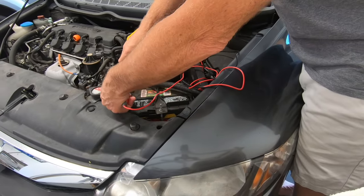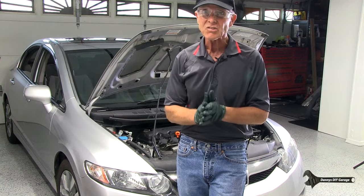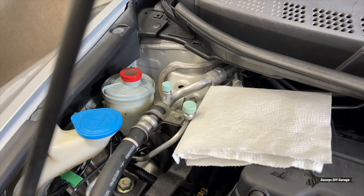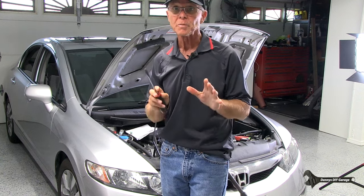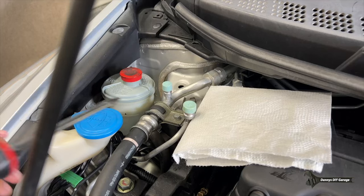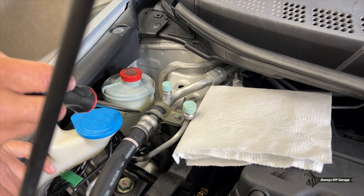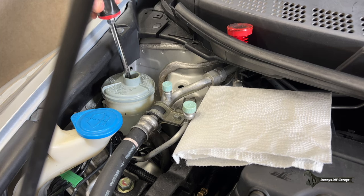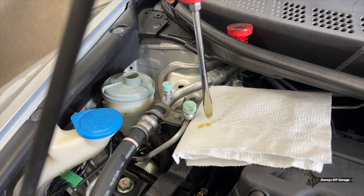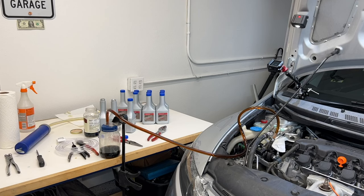This is on my YouTube page and I'll link that in the description. Next up is our power steering fluid. To check the power steering fluid, the car should be on a level surface and the car should be cold. Once it is, you want to look at the lower line and the upper line, and the fluid should be in between that. Also, I like to pull the cap off, put a screwdriver in there, and just pull out some fluid and see the condition of it. If it's not clear light brown, then you may need to replace that fluid.